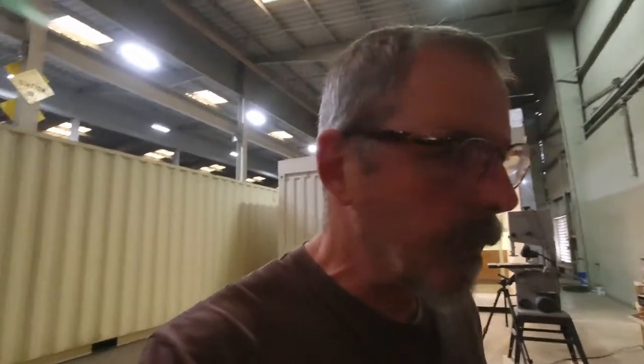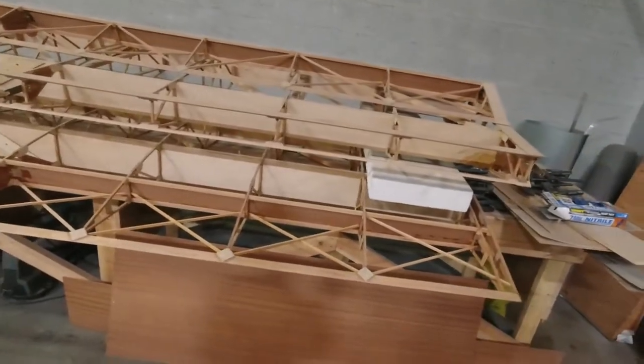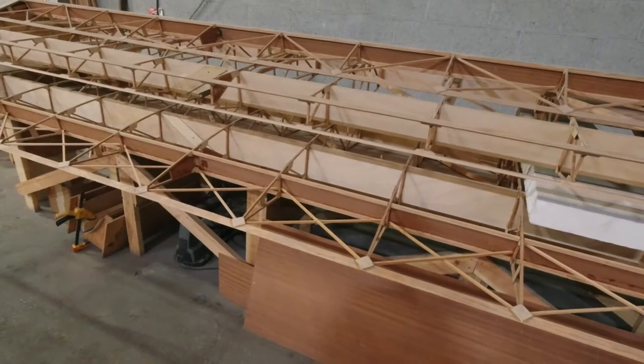And all right, so now I'll get some epoxy going, and we'll get all these things epoxied and clamped. And then I'm going to get the second piece of plywood. I've still got one in the form there. So I'm going to get a second piece cut to size and get that soaking in some water so that I can get it in the form. Get those three all set up, get the urethane on the inside of all of that, get that leading edge on. First I'll flip this wing around, weight it down, get the leading edge on, and then I'll flip it back around and put it like this again. And then once the leading edge is on, I can remove the aileron and continue down that road.